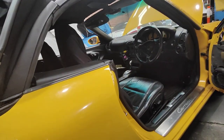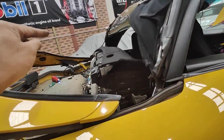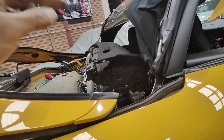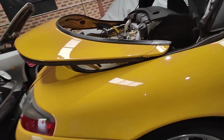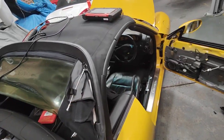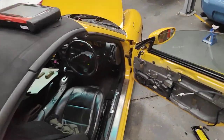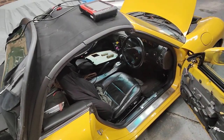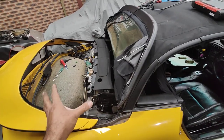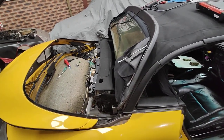No communication fault. But at the same time, I have to check the plugs, power, earth, signal, switches must be checked, especially earth as well. That has to be checked properly before I get an ECU, a new ECU from the second hand. Probably get a second hand, and then we'll go from there. But everything must be tested properly before you condemn anything.